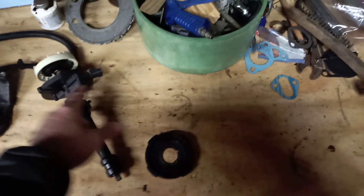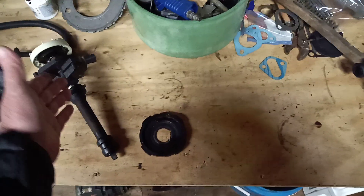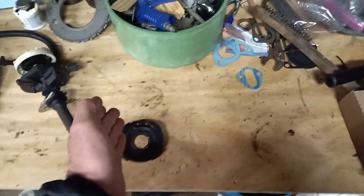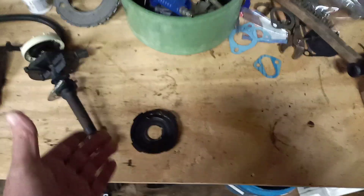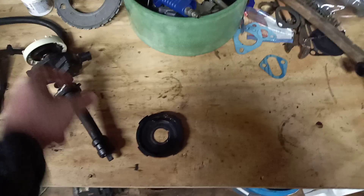The answer is they don't. All this cam sensor does is tell the computer which part of a 720-degree cycle it's in — either the first 360 or the second 360 — and then the computer has all the precision it needs from the crank sensor. There's no reason to use something sloppy like the distributor signal to time the injector fire. The reason they call it fuel synchronization is you cannot synchronize the spraying of the fuel injectors without that cam signal, because without it you can't tell if you're at 300 degrees or 660 degrees.